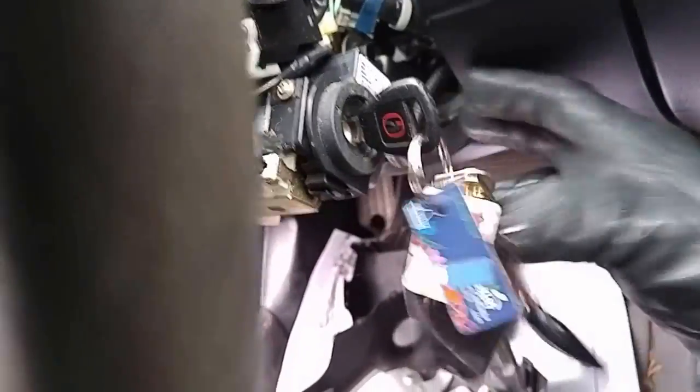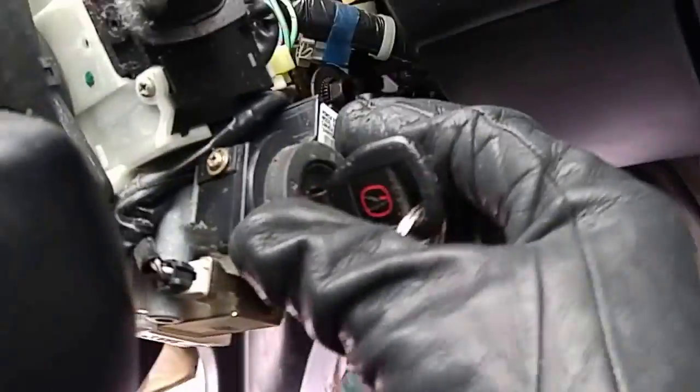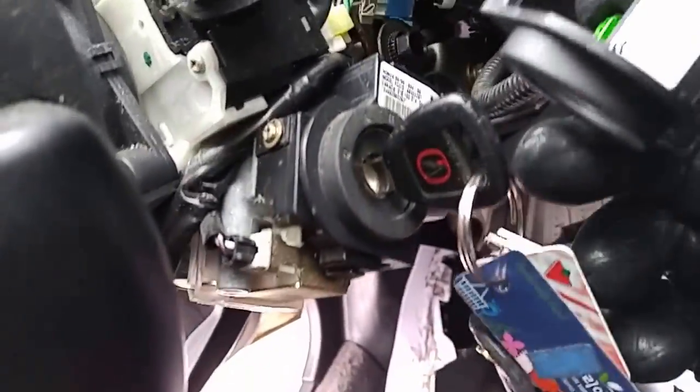If you look at the key ignition side, right behind it there is the reader. Behind it is the green connector. So basically you disconnect it and connect to your new sensor. Let me take it out and connect to the new one. So you do not need to install it right away if you just want to see whether this is the solution for your issue.